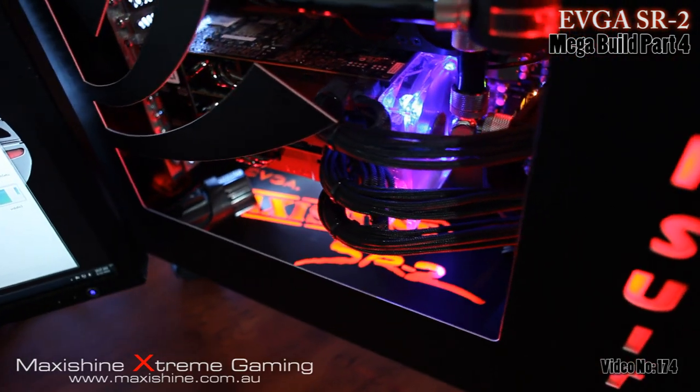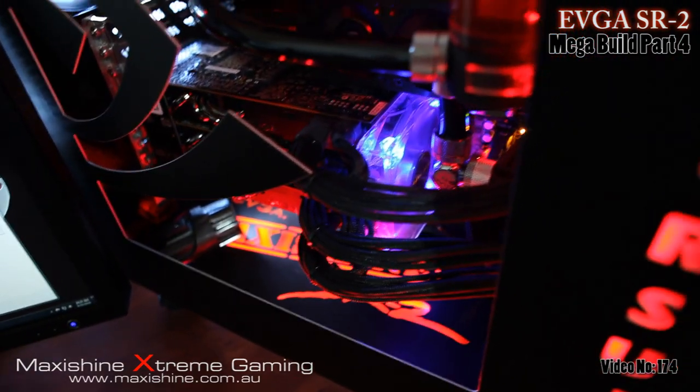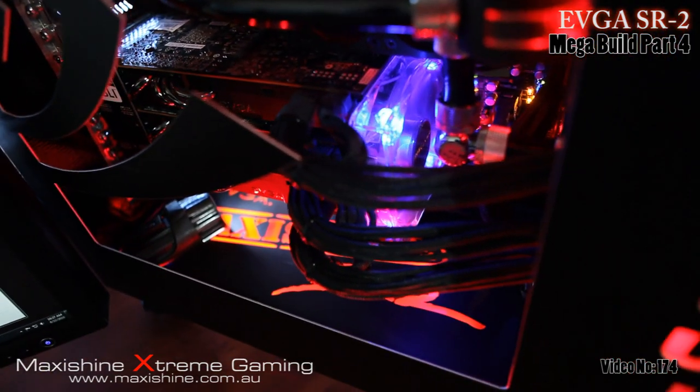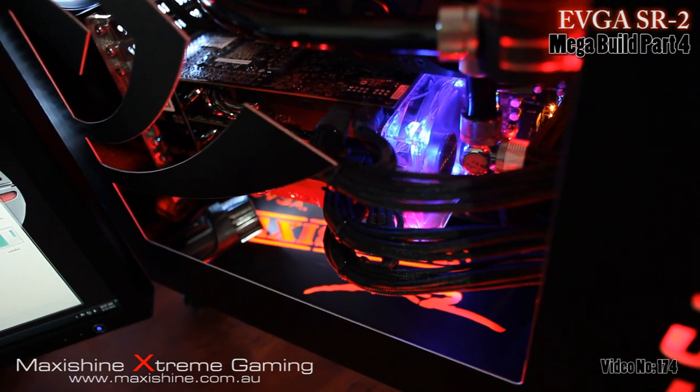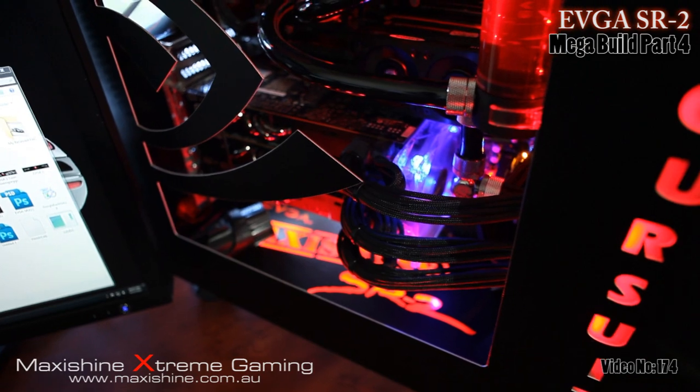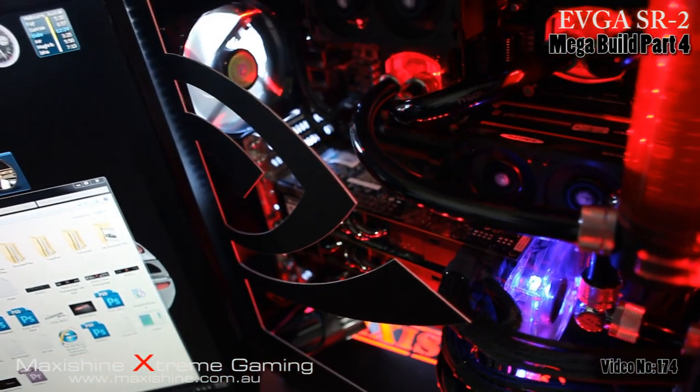I think a pretty good result in the end. I just added that 120mm fan there as a test — it's not going to remain there. It's lowered the temperatures by about five to seven degrees on the three cards, so if I do eventually keep something there it'll probably be a Cooler Master black fan like the one at the rear.